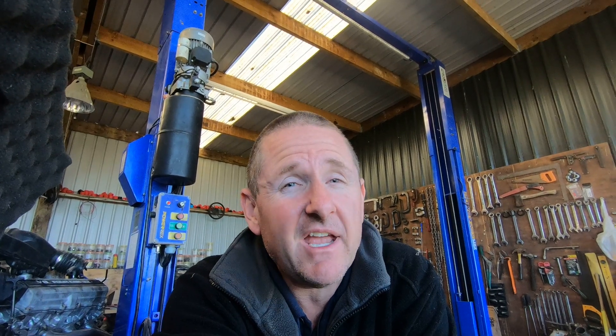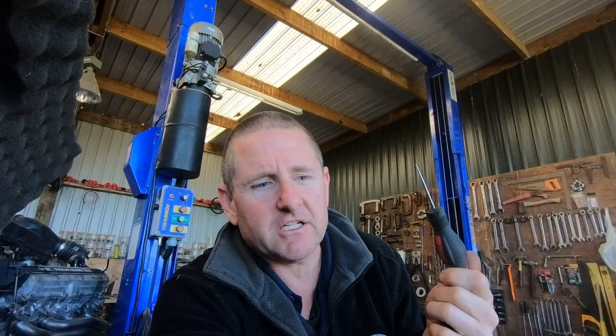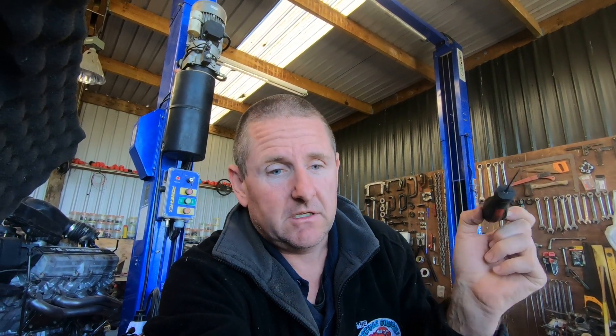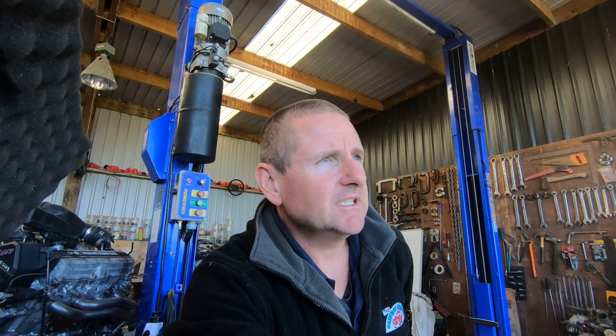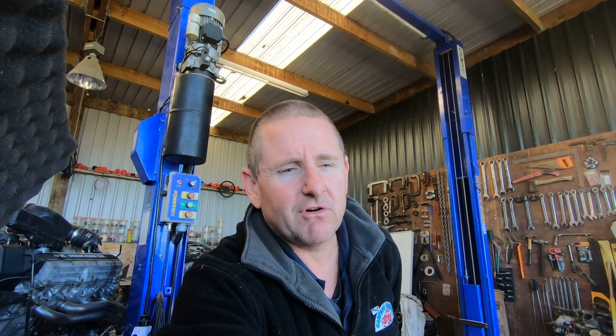Hopefully that explains the correct way of doing diagnostics and proves that it can be done using the right scan tool port. I do get a little fired up about this — I have my pokey stick to poke people in the eye when they say they can't get communication, or they've taken it to a garage who plugged into the port on the engine. If your garage attempts to plug into the port on the engine, tell them they're wrong and suggest they use the one under the dash. Hope that's helpful and you've learned something — we're going to pop a power steering pump, an alternator, and maybe some extractors on this Soarer. Talk to you later.